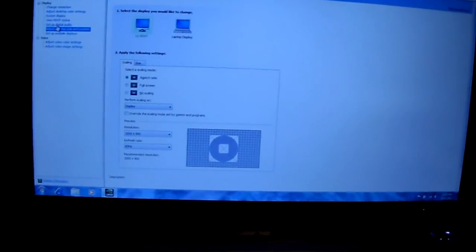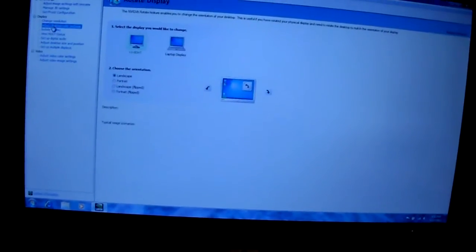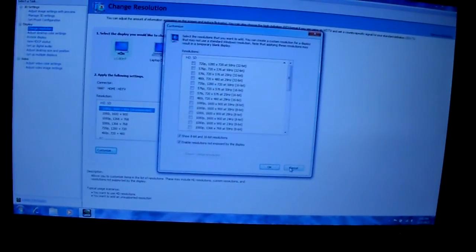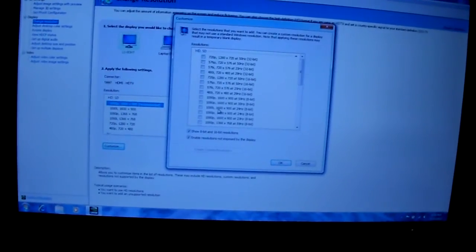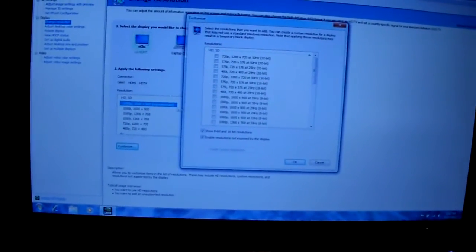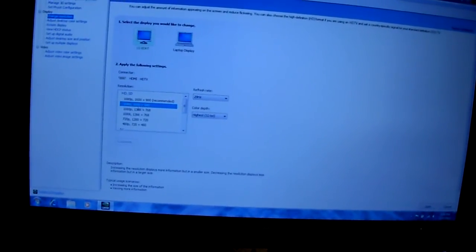We're going to walk through a couple of these real quick. I'm leaving mine at 60Hz. Now, even though this is putting out at a default selection, it's not giving me 1080i out of the computer. It does give me 1080i if I go to Custom — 720, 1080i — but it's 8-bit, which just doesn't have the colors you want. You want more of a 32-bit, at least 16-bit. The default setting of 1080p at 1600x900 recommended, running at 29Hz — that will work the 1080i and 1600x900 resolution.